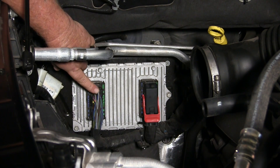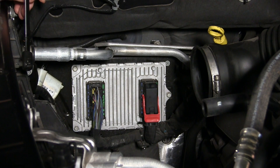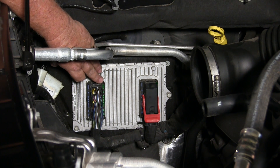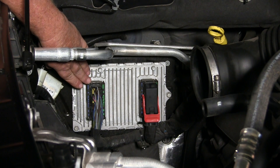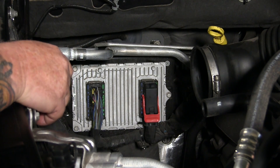Now I've got to figure out which pin I need. There's a bunch of wires here — 96 slots in this connector. I need pin 86. My eyes aren't what they used to be, so I'll take a picture with my phone of that connector and blow it up. You can see at the top right it's stamped number 24, and at the top left it says 96. So the wires run from the base up to 24, then the next row 25 up to 48, and so on up to 96. That means I just have to count down from 96 to 86 and place my probe.